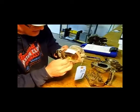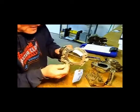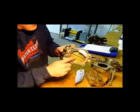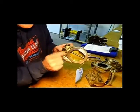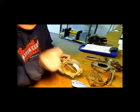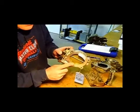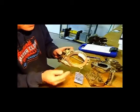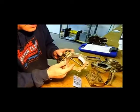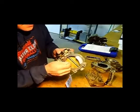Okay. And actually, this should have been grooved just a little bit closer to the throttle plate, I think, to take maximum effect of the groove. If you get 1/16 of an inch difference in position closer to the engine, it will cut your results by probably 25%. So you want this to be as close to the natural idle position as possible when you cut the groove on these controlled throttle bodies.